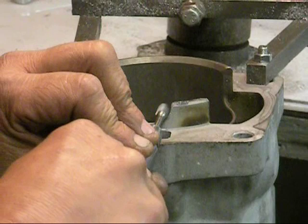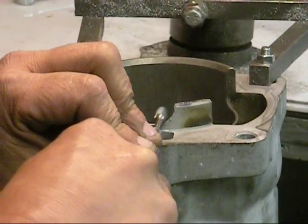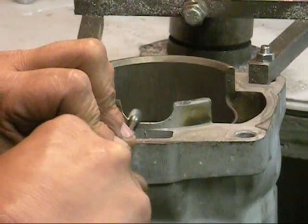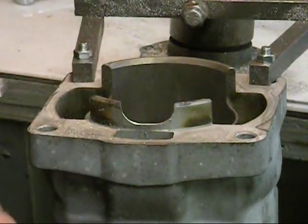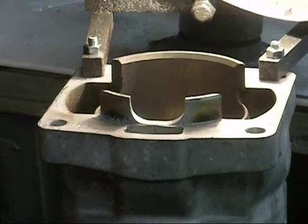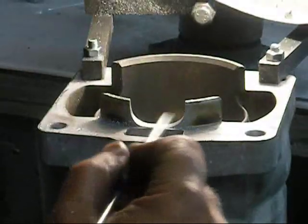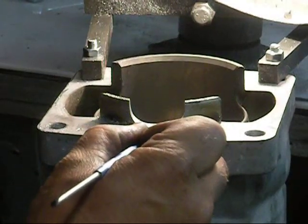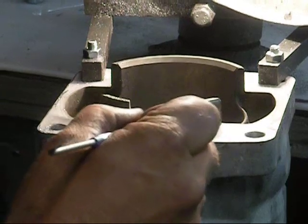I have my angle on the back — I can see it, you can't — but I know where I want to be when I end up with this, and I'm just going to grind straight until I get down to this boost port surface. We finished our blend here; we had an angle that went in this way and just kept cutting down, and as we suspected, what John's template did is it brought the skirt equal to the boost port.